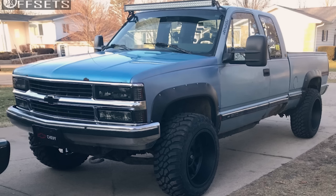Body lifts — what do they do that we don't like? The biggest thing is they really overstretch components in your truck. If you have an older vehicle like a K1500 or a 1980s or 1970s truck — something that runs on fewer electrical components and doesn't have a giant brain box controlling the whole thing — you have much less wiring to worry about. However, when you install a body lift on something newer, you're stretching all that wiring and it can create problems if some of those wires come undone or get stressed and frayed, and basically your whole truck just shuts down because it gets super confused with all the electronics.